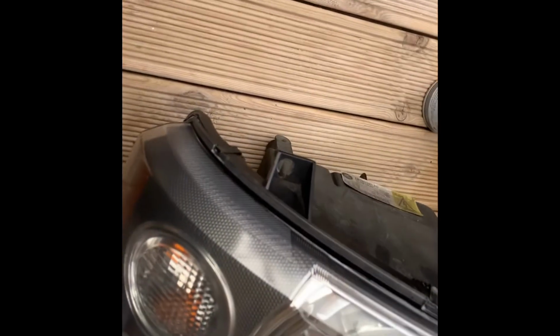Lights, and if it's a wet or dry day, it doesn't make a difference. So as you can see, I've got a bit of a patio heater, and what I do, as soon as I spray them, I dry them, make sure they stay nice and dry, and it dries quick, because if there's too much moisture in the air, not too close obviously, but enough to get any moisture off that lens. And good idea just to give it a little bit of a warm first. Good start if it's warm, and then you get a guaranteed surface really. I think the issue is if it's wet out there, it can haze up. They can go white if you're not careful.